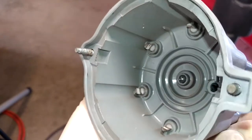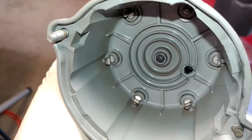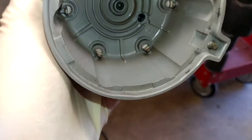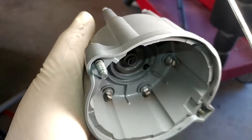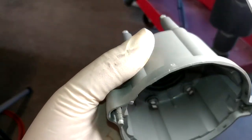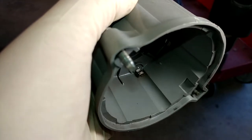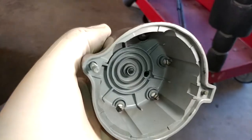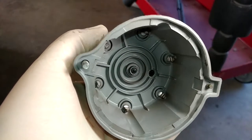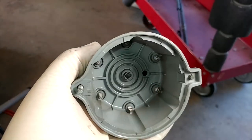Good thing to be putting the new parts on. The cap doesn't look a whole lot better — you can see where the rotor has been running around those contacts and it's got a good bit of wear. That aluminum is all oxidized — that's what all that white is. And there's actually charring — those little black spots — that's probably arced and sparked and done all kinds of things that probably aren't good for the health of the vehicle. But it was running just fine. Time to get the new stuff thrown on because this stuff has certainly seen enough use.